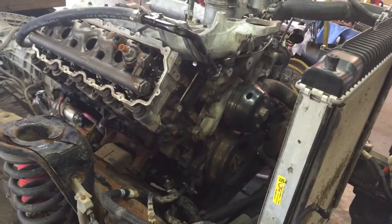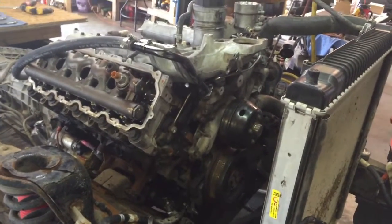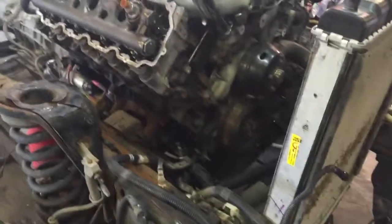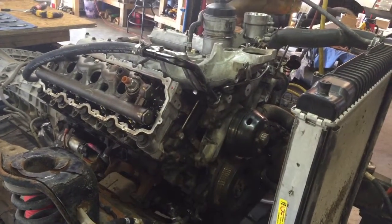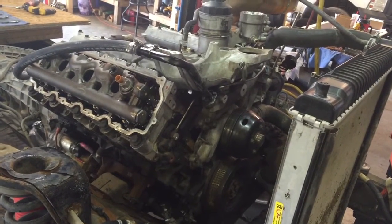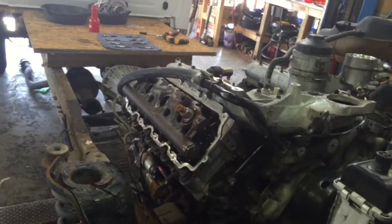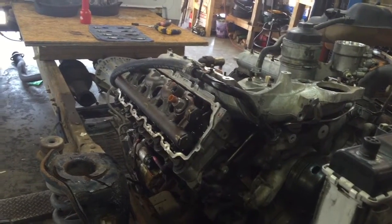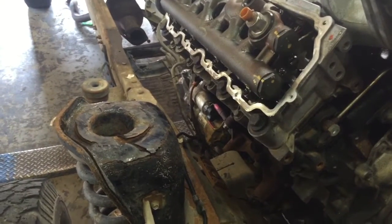So as far as it cracking, I think we're just looking at a plain old EGR cooler failure taking out head gaskets. All that milkshake up on the valve cover says head gaskets right there. That says it's blowing into the oil passage. But I'm gonna go ahead and do one more crank. I've been stalling because if there is a leak in the head gaskets, it'll throw some coolant into the cylinder, and you'll see it right here. Here we go.